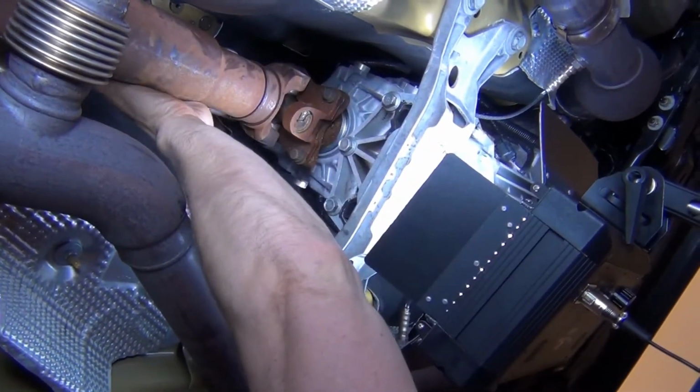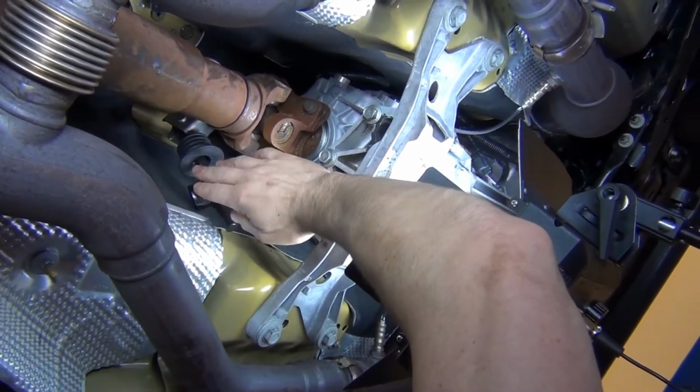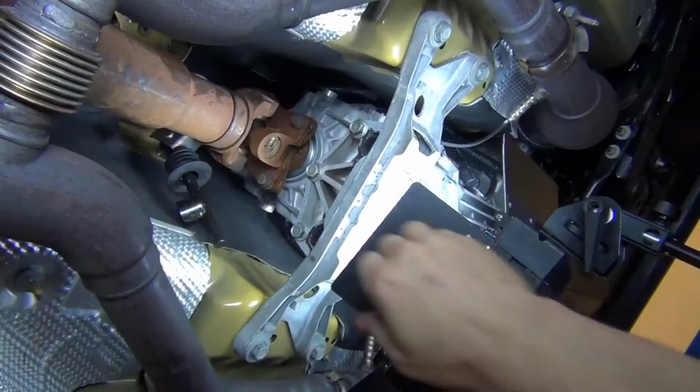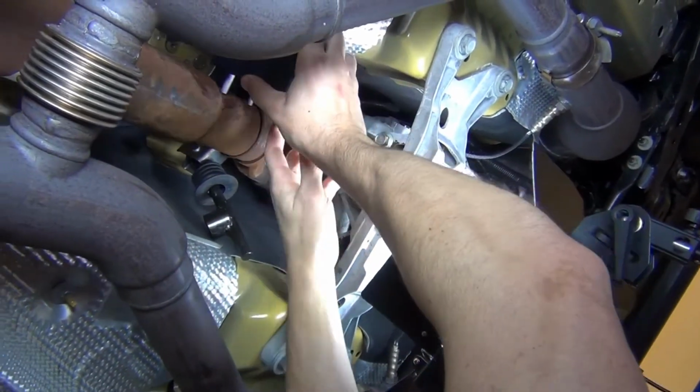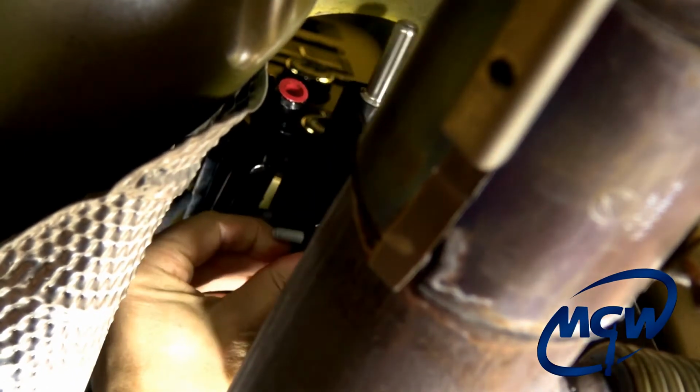And we want to take the linkage arm for right now and move it to the driver's side, fold it away all the way over to the side, and push the side support arm all the way up. Then we'll slide the box. It'll rub the drive shaft a little bit, no worries there. We'll bring it up and around, and then we'll pull down on the side support arm a little bit, and get all four set screws lined up and then slide it right on top, and you can let it go there. It hangs right on top of the four studs.